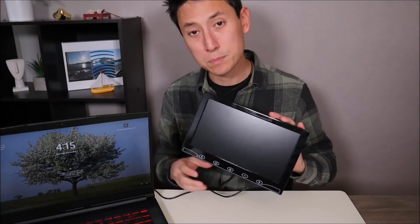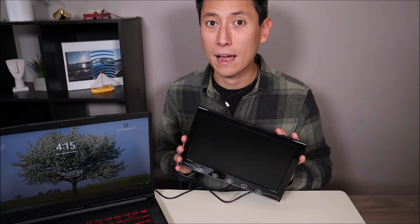If your external monitor is also black — not getting a display just like your LCD — you may be looking at a motherboard issue, because no signal is being sent out. Some more complex computers can be troubleshot down to the GPU or other components, but with most consumer laptops you're looking at a motherboard issue that may need to be replaced. One last thing you can try is a manual BIOS reset — there'll be a video link below in the description showing you how to do that procedure on a motherboard.